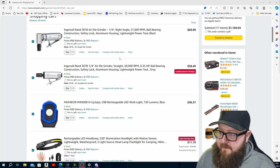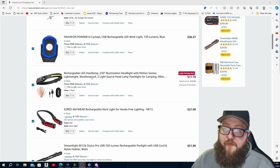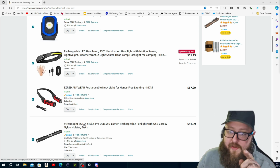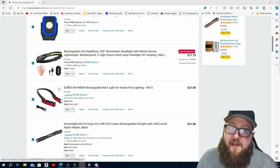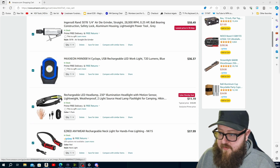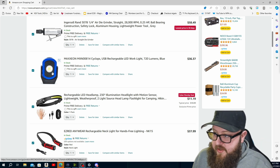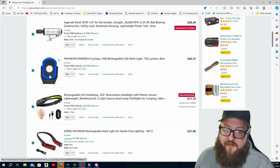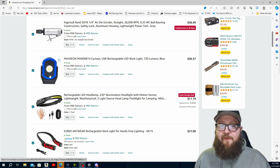And then moving on from die grinders and cutoff wheels, you're going to have some lights. I have 4 different options. I have a pen light that you will lose. Just go ahead, you're going to lose one, because I lose them all the time. Some neck lights come in real handy if you work on heavy duty equipment or diesels and you're sliding underneath them on a creeper. Or this headlight that's real low profile, so it's kind of nice and has the hand motion on the side. And then a magnetized floodlight that you will leave on a frame rail, guaranteed. You will leave one on a frame rail, and then you'll either learn or you'll be like me and just keep buying lights and keep leaving them on frame rails.